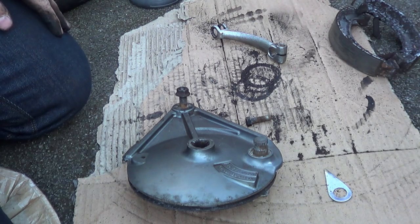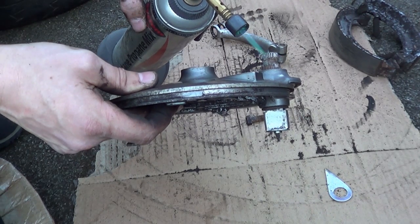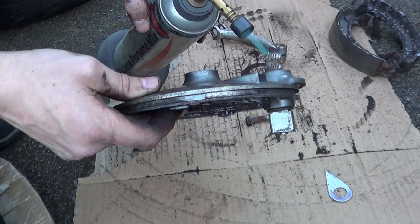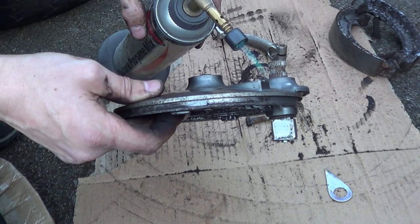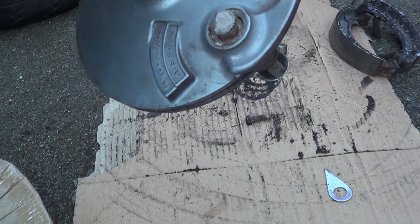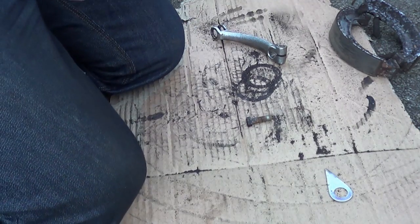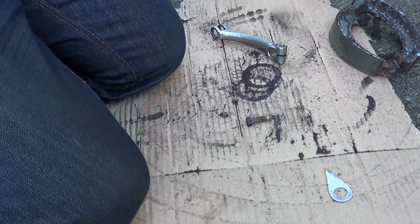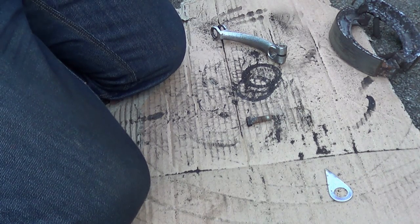We're going to give it one go with the heat, so we need to get this pretty hot. There's quite a lot of metal here, so quite a lot of heat. See, that took one good strike, just as hard as I've hit it before, and she's popped. So we'll whack it a couple more times and get the sucker out. Must be around, I don't know, 100 degrees, something like that still, but we've got it out, which is all that matters. Ta-da!